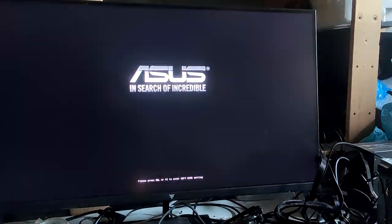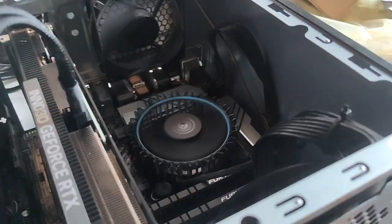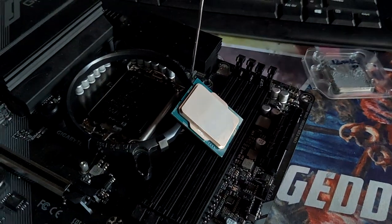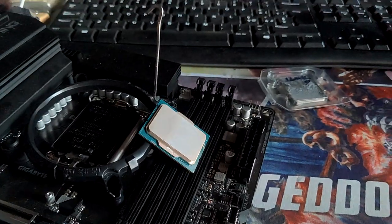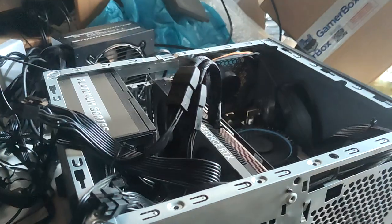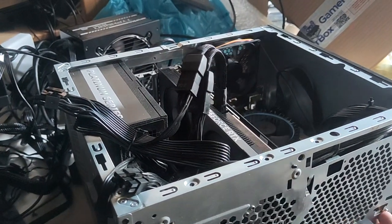And so yeah, this all makes sense now, finally. And so I swapped the CPU in order to get the undervolt on this machine, because I also run on a stock cooler. So if I try to overvolt the 12500 to get proper performance, I would actually get into a temperature limit. But with the 12400, yeah, here it is. It's crashed already. It doesn't get to the desktop with -50 millivolts. So it made much sense to swap to the 12400 for this build, because it can run quieter, more efficient.